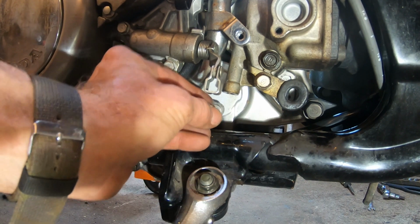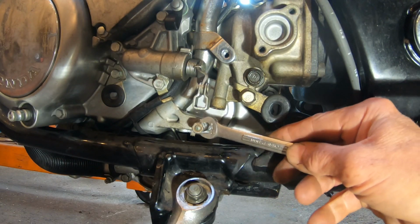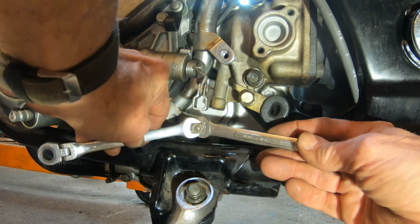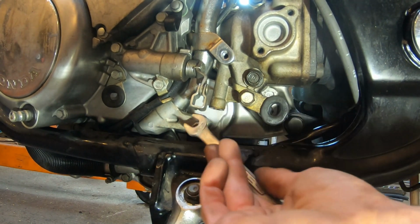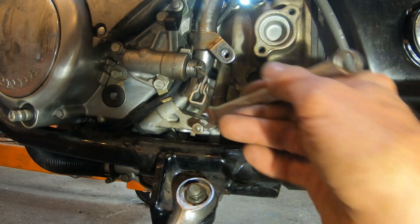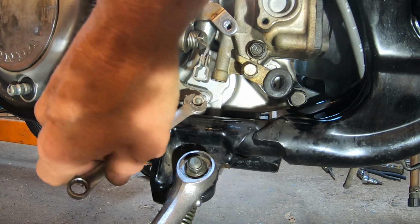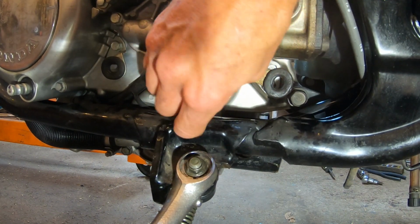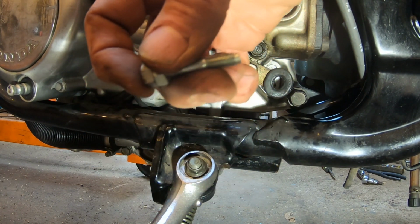And then we're going to turn the second one on right on top of the first one we put on, and then we're going to tighten them together with two open end wrenches. Like I say, once we start tightening, the stud is turning out. And that takes care of the stud sticking out. Indeed, it was threaded in a long ways, but it was recommended to remove this stud before pulling the engine, and I could see it would catch on the frame.